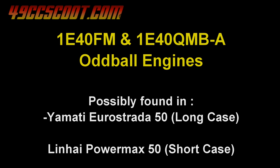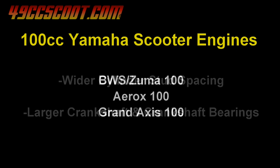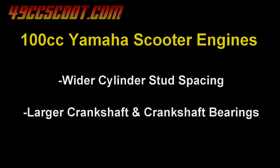Some may think of the 100cc Yamaha BWS, Zuma, Aerox, or Grand Axis, but those are a bit different platform. They have some similarities, but they have a wider cylinder stud spacing and use larger cranks and bearings, so they aren't compatible with 90cc builds. They also seem to be hard to come by in the US and expensive if they are located.